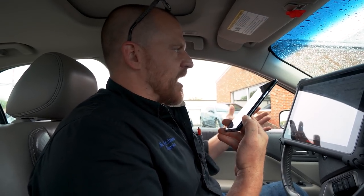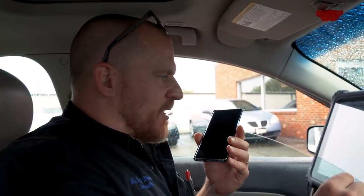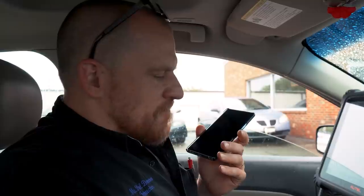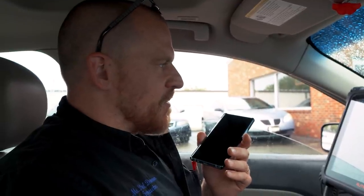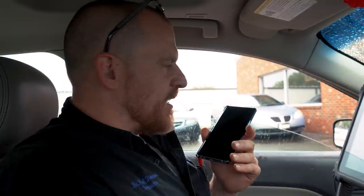For sure. But we do risk it's going to ice up. So what damage? When it ices up, it's icing up on the outside. The inside's not really as important. Yes, but your head pressures are going to go high eventually. Well, it's got a high pressure sensor, but it wouldn't be a clog in the actual AC system. It would only be an external clog. You'd still have refrigerant passing through, just at temperatures lower than what we want. It's not going to freeze internal. Our internal flow is still going to be proper. It's just going to freeze external from humidity in the air, and it's going to block it up from the outside. Our pressures will be affected just because of heat exchange, because you're not really pulling any in, but I don't know.